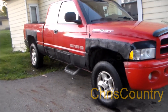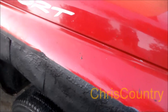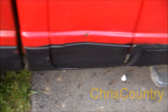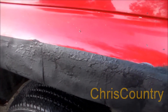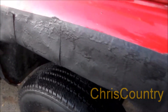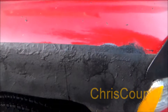I will be the first to warn you guys, I am not a body man, or not that great at body repair. But in the tour video I really didn't show you too well the exterior, but over here on the fender and stuff there was just epic, epic rust. Down on the doors was rotting out, the back door surprisingly was fine, and of course back over the wheel well — this is typical for pretty much any Dodge of this generation to get this rust. The fender especially was just too far gone for a typical bondo repair, and I really don't have the equipment to weld metal on, so I just basically decided to take sandpaper, spray paint it black, and basically glue it onto the body, then spray over the top of it with bed liner in a can.